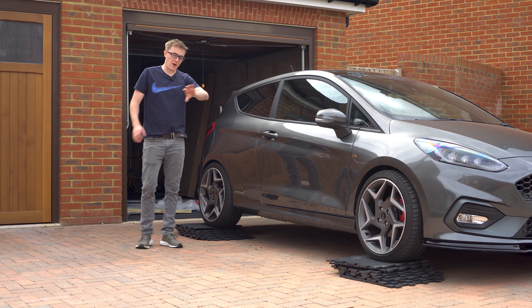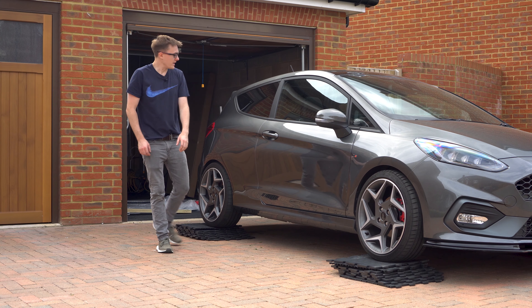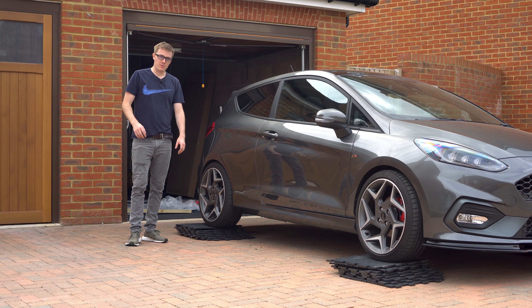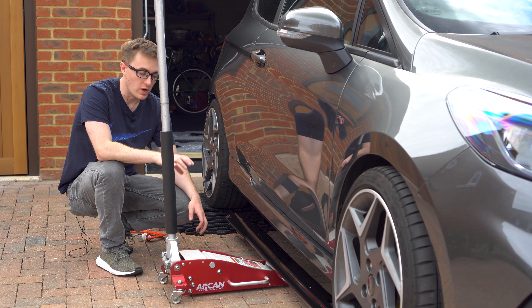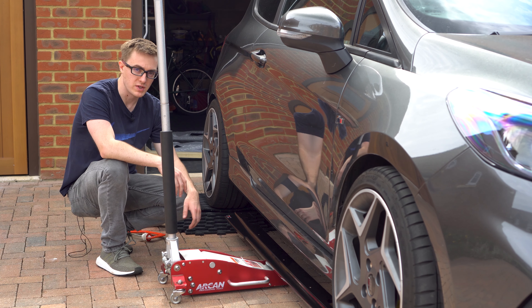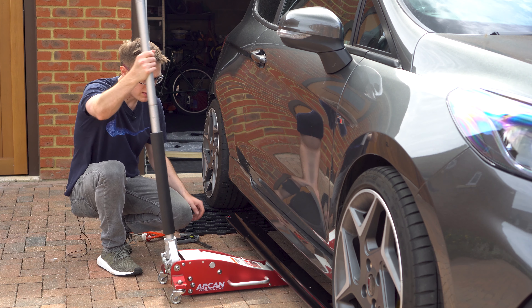Before fitting the side skirts, I went for lunch and figured I was wasting a lot of time jacking the car up because you really don't need to - so why not just drive it onto something. I've got some off-cuts of my garage flooring which I made into a little ramp and drove straight up - really easy. I would probably recommend doing it this way; you can just use wood or anything you can drive onto. In terms of lining the side skirt up, it's a fiddly job. I'm using a jack to move it around and up and down, and when it's roughly in the right position I can focus on the two ends, clamp them together, and then secure it.